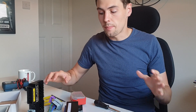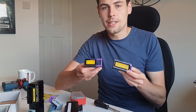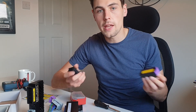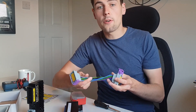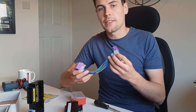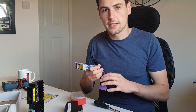What we're going to be doing today is matching up the plug and play adapter with the connectors on the EMU black. One thing to note is that if you are using a plug and play harness on an EMU black, the two black connectors are actually different sizes — that's because the EMU black has more inputs and outputs than the EMU classic that these plug and play adapters are designed for. Putting together this plug and play harness is quite straightforward. I've already done my grey harness just to make sure everything was as expected, none of the pins were broken and they were all the correct size.